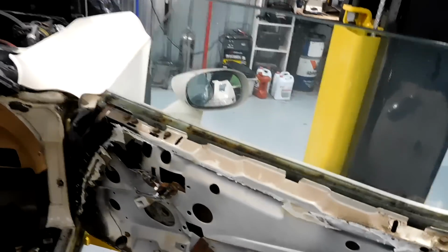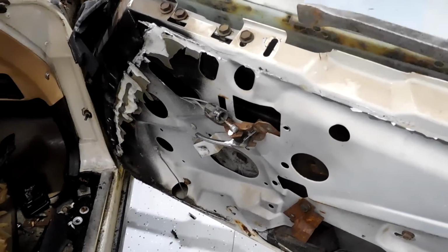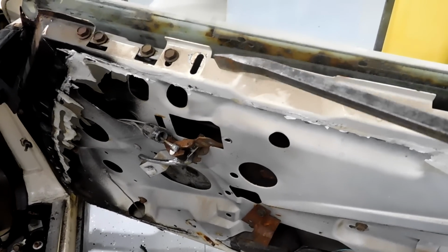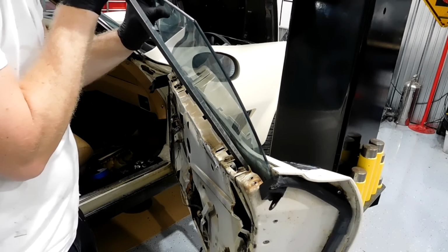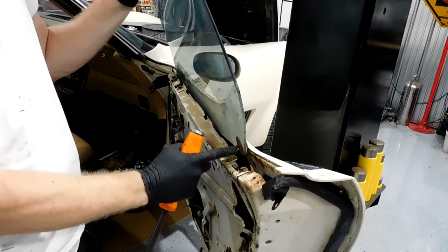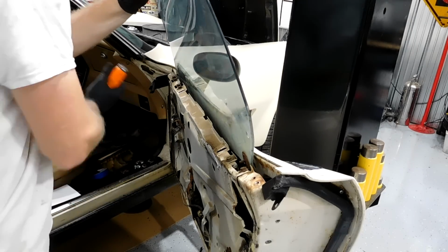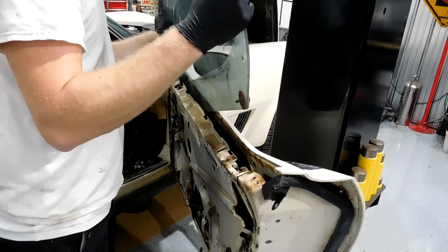And then the issue you're gonna have is there's a roller, you can see it, down in that track that will come up. You see it right there? It'll come up. And then you will need to lightly and nicely pry between the fiberglass door and the metal door skin just a little bit, and then it'll pop straight out. So I'm taking my pry bar, prying out, and so here's that stud that was in that track, okay? And then you're gonna wanna put this down somewhere where you can reach it. Next, you're gonna wanna lift the window up.